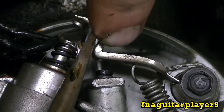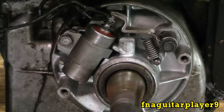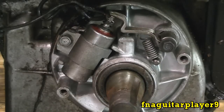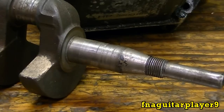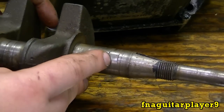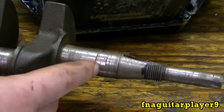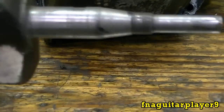Your points over here open like this. There's a little plunger — round, sticking up right there — that's what lets the points close. I'm going to turn the engine over so you can see how the points are opening. They'll close just for a split second. They're open the whole time until it gets to that one point and they close just for a split second. On the crankshaft, there's a little dip right here where the spring tension forces the plunger to bottom out, then it opens right back up — similar to a lobe on a camshaft but working opposite.